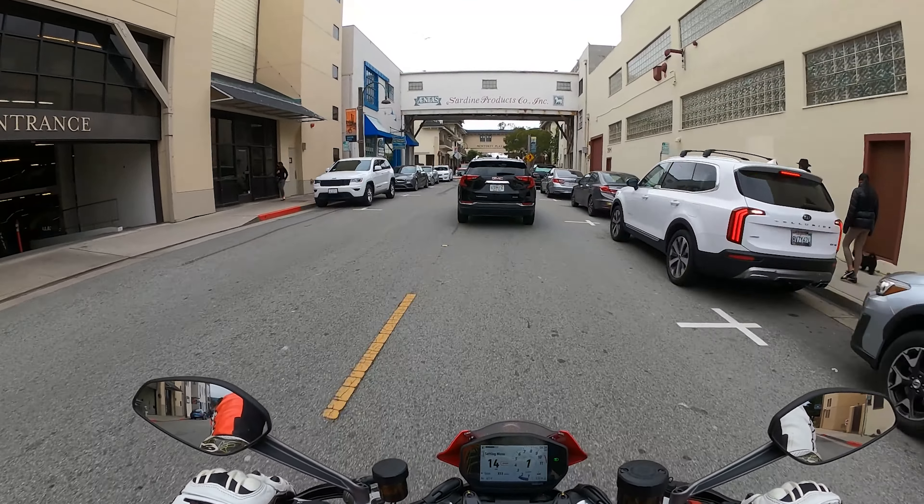The Ducati sound is back! With the Ducati 821 I feel like they lost that Ducati sound, and we have it back now. It's a very nice tone — it's got little crackles and pops, bings and bangs, and it sounds really good. Welcome back to the sound of Ducati. We're in a wet clutch — hydraulic clutch with the new 10-disc clutch kit. They've gone from five springs to three springs to make it easier to pull in, and the hydraulic slave gives it more pressure when released, engaging those 10 clutch plates even more.